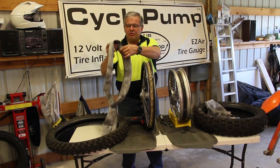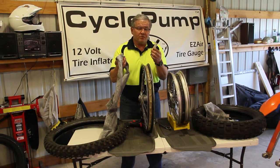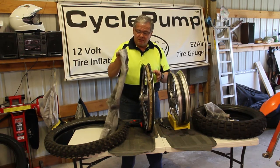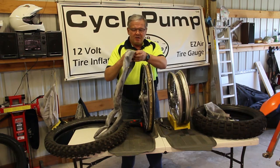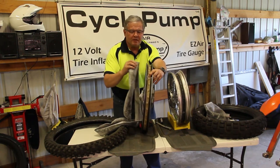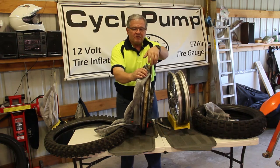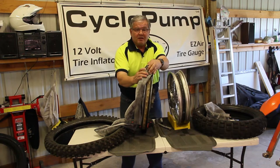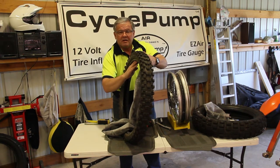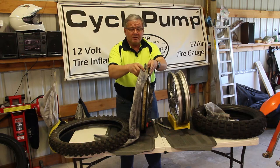Let's take a look at a typical tube. This tube has been well-talced — we sell a thing called the talc tube, a simple tube that contains talcum powder. The purpose of the talc is to lubricate the tube inside the tire carcass. If I'm going to put in a new tube, I'm sticking it through the hole in the rim right here — easy without a tire, but as soon as I try with the tire carcass on the rim, there's simply no room.